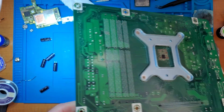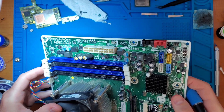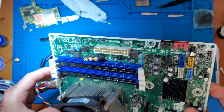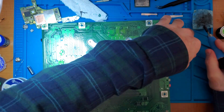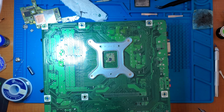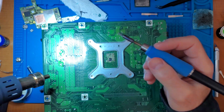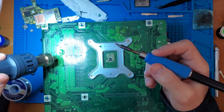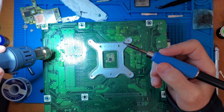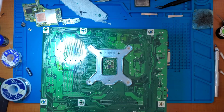I just remembered I might want to check the polarity of these. They've got a polarity marker there — the negative goes on the right side. Now that we've got the old caps out, we do need to get rid of the old solder. The easiest way to deal with this is to heat the board up first, and then we're going to use our wick — a three millimeter wick. I've got the heat gun set to about 450. I'll apply a little bit of new flux. I think I got it all cleaned out. Okay, let's get those caps in.